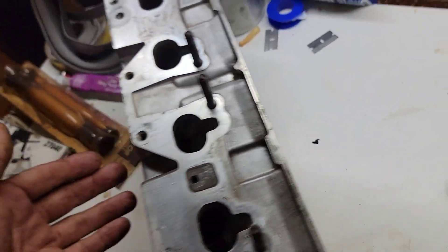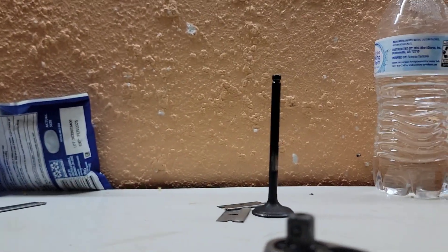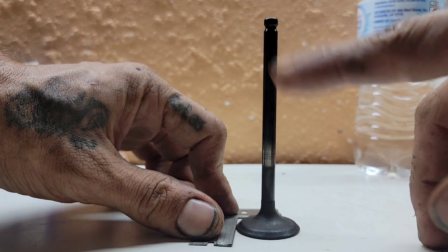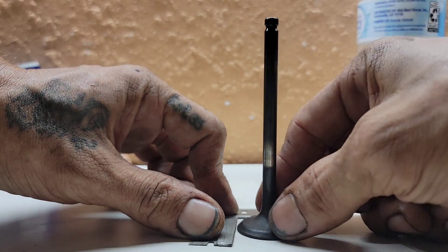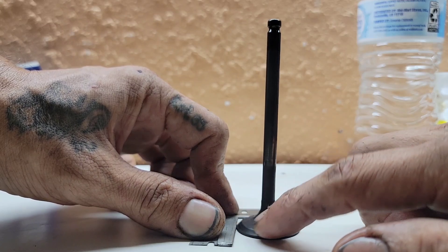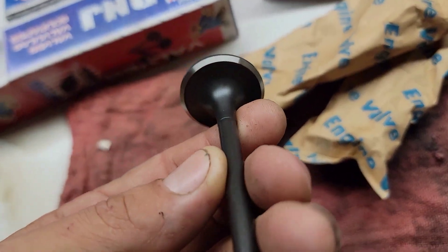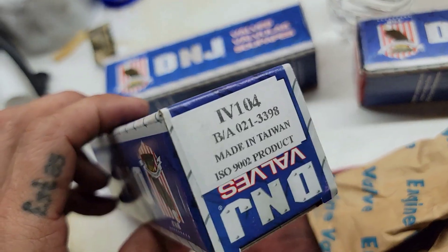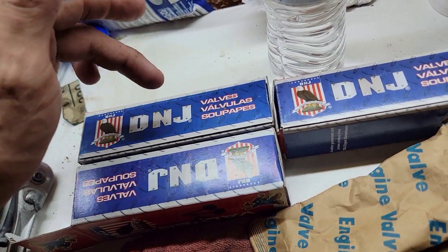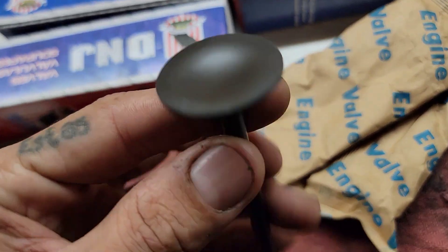Here's the cylinder head. I took off one of the valves from that damaged cylinder. I'm going to set it here and rotate it to look at the movement on the stem. Turns out this one is bent. Here's a new valve — the brand is D&J. There are two intake valves and one exhaust valve. They are different sizes — I think one is 28 millimeter, one is 31, and the other is a little bigger. Three different sizes. That's the one that got bent.